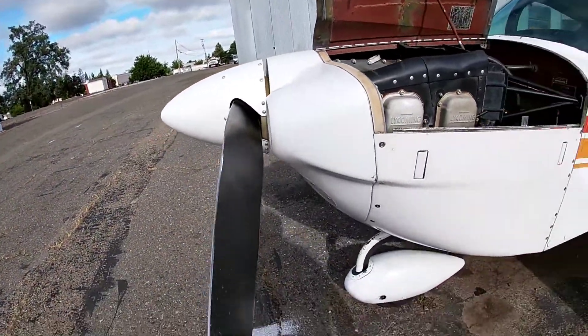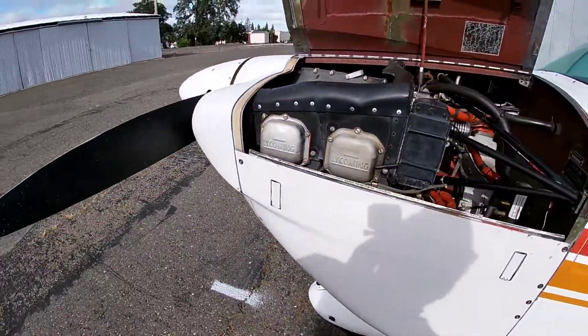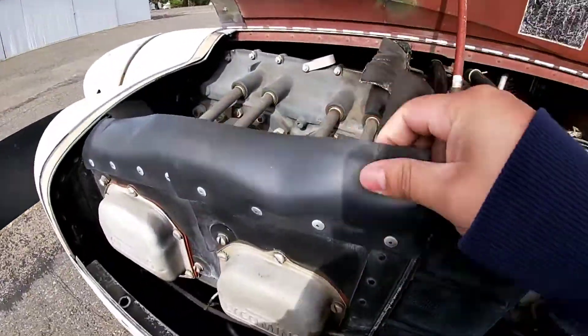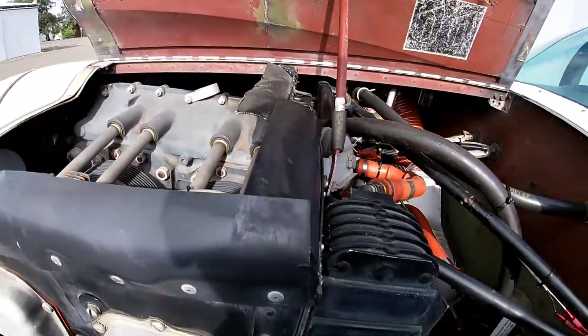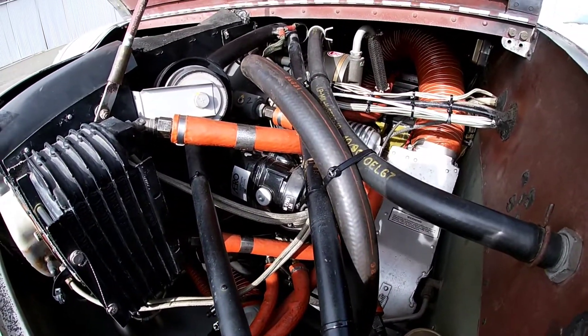Let's see if it shows up for me on camera. There's a starter — there should be a shroud on it now, which I can't see. I'm just aiming the camera in there, but whoever put this on originally did not put baffles around the starter. That takes away cooling air from the engine, so fixing that should help as well.